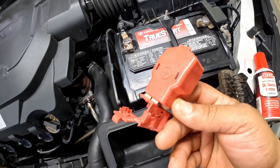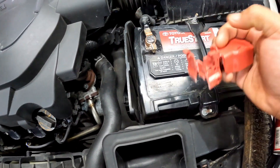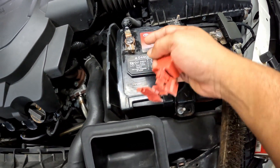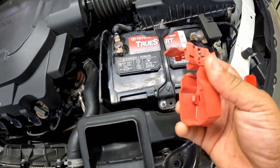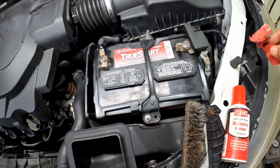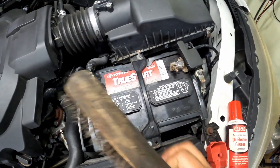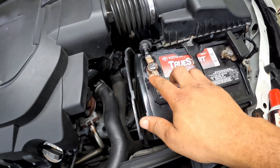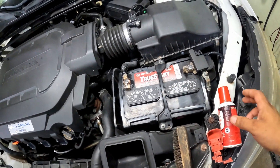So far, what I did was I took this cap off because when I pulled it up I noticed there was a lot more corrosion all up in here. I took this thing off because it's basically just a housing for corrosion, so this is going in the trash. I took my wire brush, cleaned it all up on both sides again, and put some more dielectric grease on there.